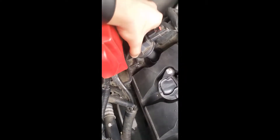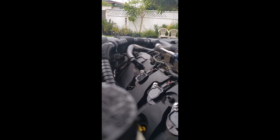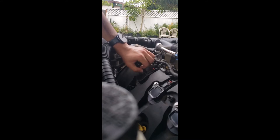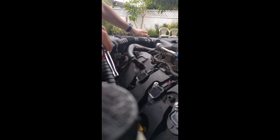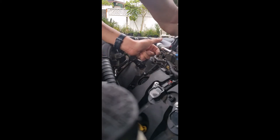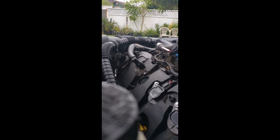I'm gonna do the other side. I used the 5/16 to unscrew that. With the 5/8 it's pretty easy — just like that, I got four more to go. Make sure you buy anti-seize, that's really important, it's well worth it. Quick tip: you do not need to unplug these connectors or take this thing off.